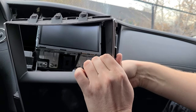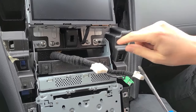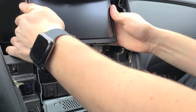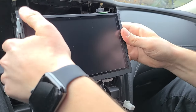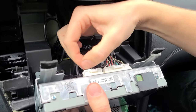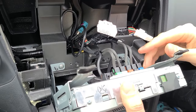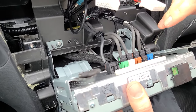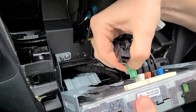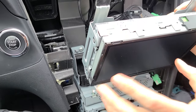Once we have the screen at the back, there are three connections — you just press on the clips and disconnect them. Next, we're going to remove the upper screen, which is held by two bolts in the middle. We use our Phillips, grab it from the bottom, and tilt it out. These are the top brackets that have to go in first when putting it back. On the back there are two main connections — click on them and remove them. Below that, depending on your particular car, you'll have additional connections, but they all have a clip which you press to remove them one by one.